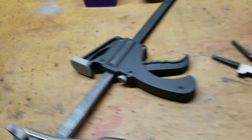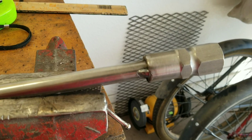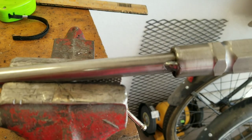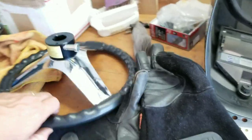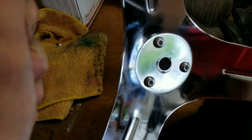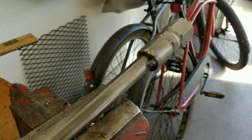The next thing to do is to install this little weldment. Now's the time to weld on the quick release. I tacked it up on the cart, lined it all up, and made sure the steering wheel was straight and the pitman arms were straight. Just want to make sure it's all straight to your steering wheel — not a whole lot of adjustment once you do this. I went ahead and got some stainless steel button head screws: quarter inch, three-quarter inch long, 20 pitch. Those work real well and look kind of neat too. Now I'm going to go ahead and weld around this.